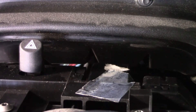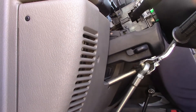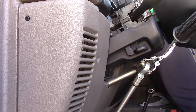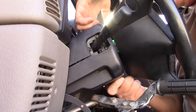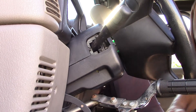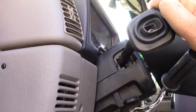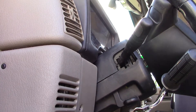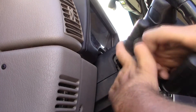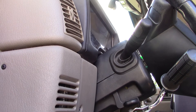Put this thing back together. To reassemble, all you need to do is put on the bottom cover here. Don't worry about mine — I drive with hand controls so there's extra stuff in here — but really the bottom and top covers go on pretty easily. The cover is held on by two screws: one goes right behind the steering wheel and one on the other side. Remember the rubber boot tip: the square flat side goes towards you. Put the lever in the central position and shove it on — it goes right into place.